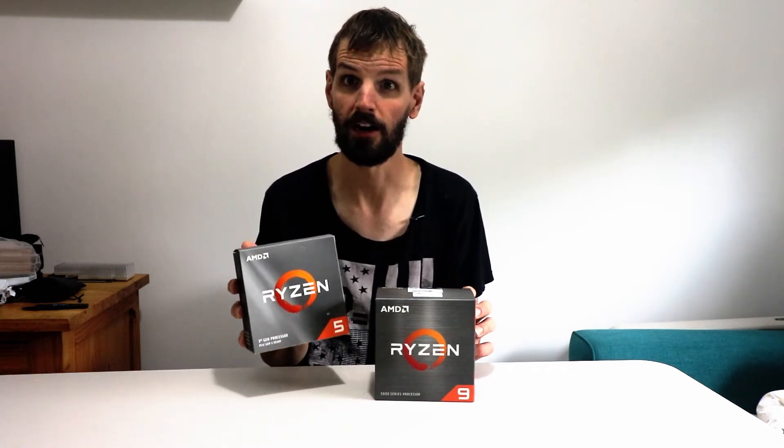Which one should you buy? Before you buy this, research it — see if you need it. Also remember, the Ryzen 5 and Ryzen 3 come with their own cooling fans, so bear that in mind for cost. But the Ryzen 7 and Ryzen 9 do not come with their own fan. When you buy this for a new build, please be aware you have to buy a separate fan or water cooling — an AIO — which I do have.